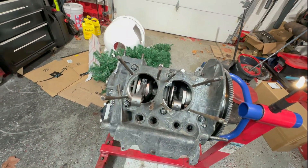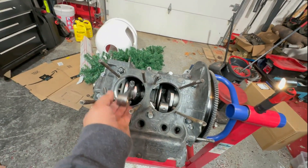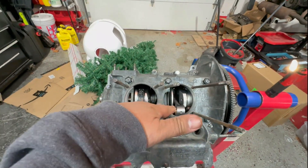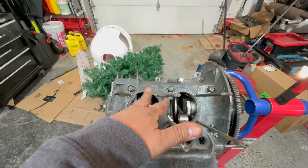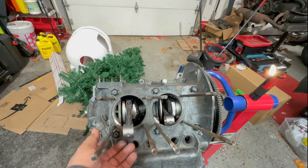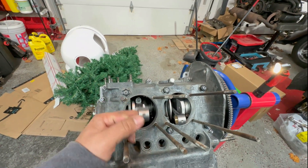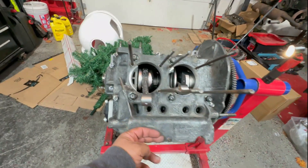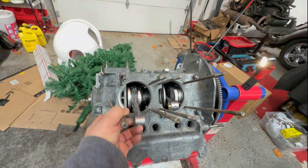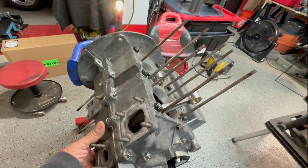I know some people freak out about using the red sticky oil instead of engine oil. If the engine is going to start right away — say in about a week — that's fine. But if the engine sits and the oil doesn't get splashed around, you'll lose oil to the bottom of the case, and when you start it up you won't have much oil up top unless you do a no-start and confirm the oil pressure light goes out — and some people forget to do that.